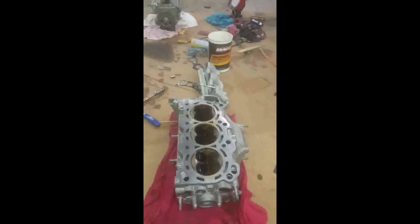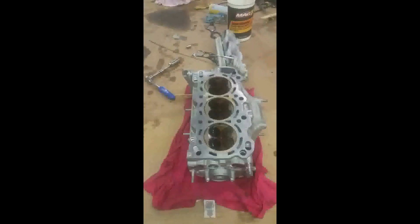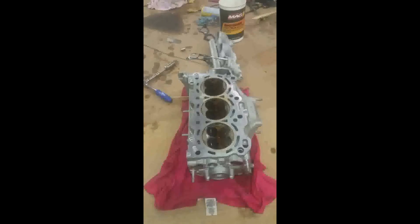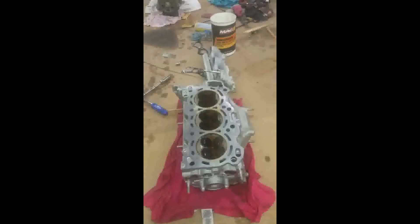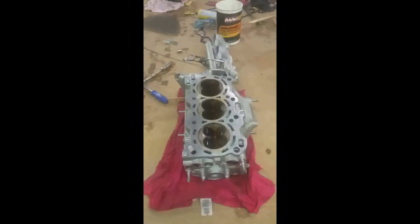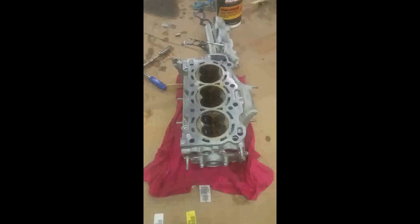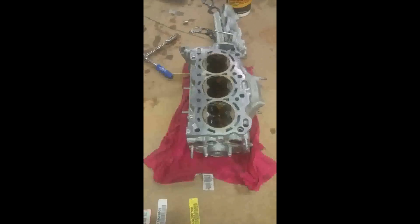When the head is still on the vehicle you could do a compression test and that is what I did before I went ahead and took this thing all apart. I did a compression test on every cylinder — you want to make sure the compression is within 10% of each cylinder. I was getting around 220 PSI, 222 on the rear, on the first, second and third. My fourth was like 195, and then fifth was still 180, and then my cylinder six was barely pushing 150 PSI. So this is how you do it — please subscribe to my channel and I will be posting cool videos daily. Any questions just shoot me an email. Once again, thanks for watching, this is George with Melnext Automotive.